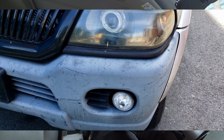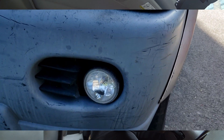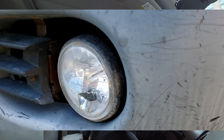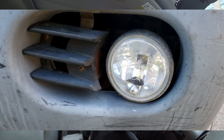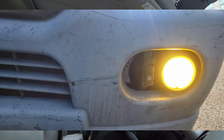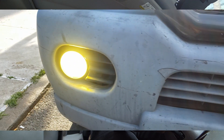Here we're going to visit the driver's side fog light that didn't want to turn on for some reason. Before this, it blew two ballasts and I thought it was the ballast. But after a deep inspection, I found out that it was a wire harness that was corroded and it didn't let the electricity pass through. So I changed the harness and bam — fixed.